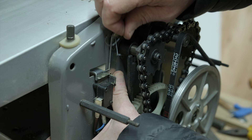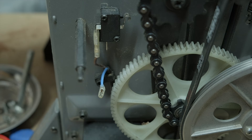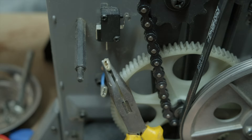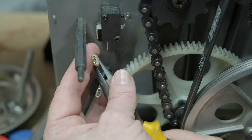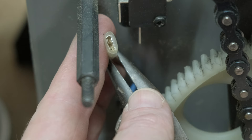The little spring goes off this hole, wraps underneath and around to there, just making sure the switch has contact the whole time — so at least I figured that one out. I've also noticed that this safety switch faces upward, so when you take it off it had a bunch of sawdust and nonsense inside, and it still has a fair amount in there. If this were to stop working one might imagine that sap or sawdust getting into that connection could stop the machine working.